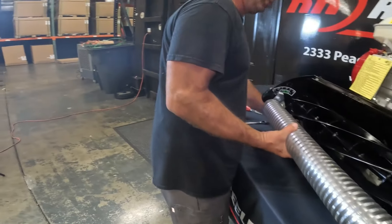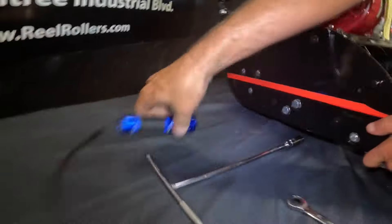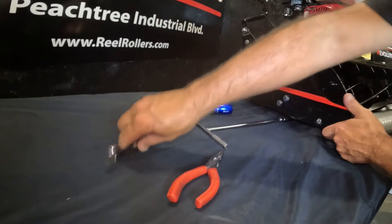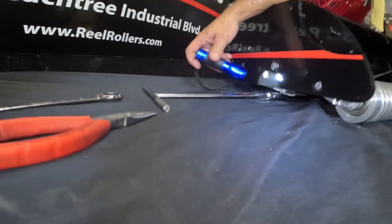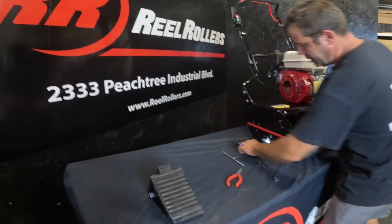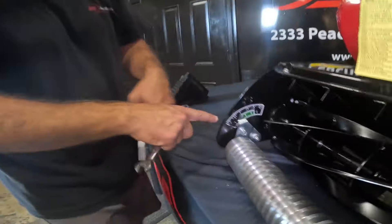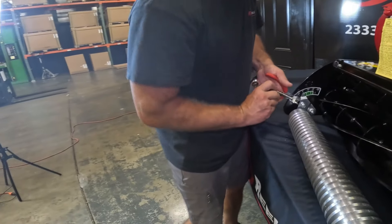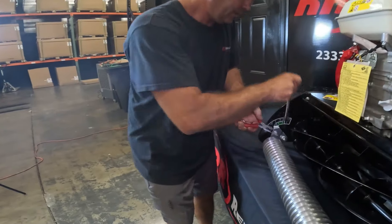Here's the trick: I'm going to lift the mower up and hold it, then put my T-tool — which we know is set perfectly from the other side — right underneath the bed knife. I slide it right under the bed knife where I had it on the other side, then tap the mower down until the tool is underneath the bed knife in the same location as the other side. That means both sides' bed knife are equal. Once I feel good about it, I come back over and tighten this nut and bolt combination really tight, because honestly I don't want any chance of it coming off in front of the reel.